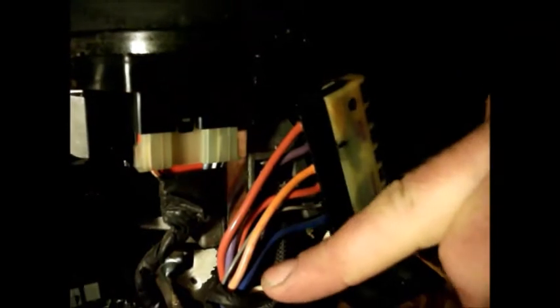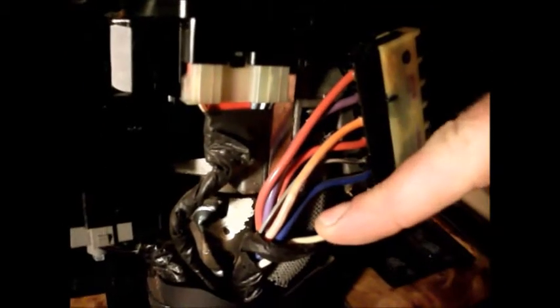So this yellow one gives me live, so if I break into that wire and take the power from here to the back of the relay in the fuse box, and that's the terminal which I showed you earlier, the terminal which is the switched 12 volt input, then as far as I can tell, it should start on the key once I've done that, and I will have completely bypassed the immobiliser.